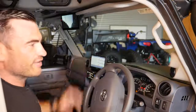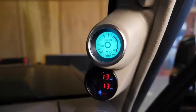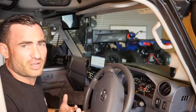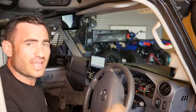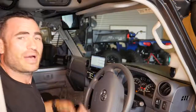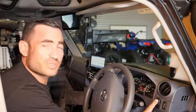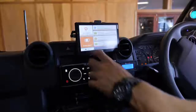Working around the dash, I've got the Redarc boost gauge and exhaust temperature gauge. The exhaust temperature will tell me how hard the motor's working and when I really need to back off and let the thing cool down. My boost gauge will show how hard the turbo's working. I've got a digital gauge for my airbags in the rear, and switches down underneath the HKS computers that allow me to pump up or lower the airbags on the fly while I'm driving. I've also got an onboard ARB twin compressor — that controls the airbags and pumps up kit for flat tyres.